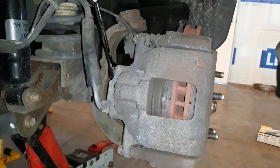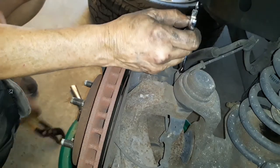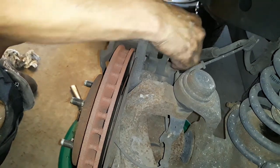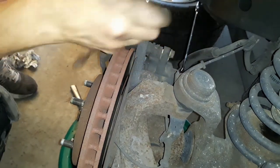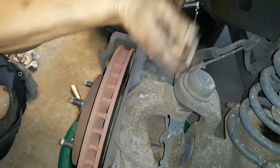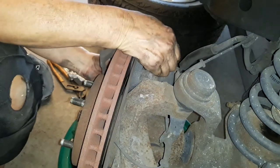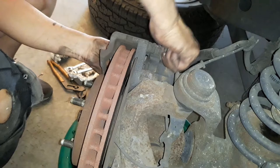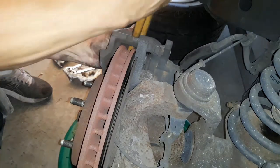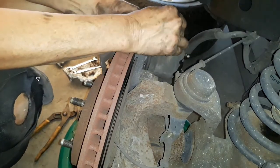These brakes are such a piece of cake to do. My rotors were in great shape so I opted to just do a straight change out of the pads. The pads on the rear were in some pretty pitiful shape — I was lucky to have maybe about an eighth of an inch left. On the front I had quite a bit more pad; I would say they were probably two-thirds used, so I still had a third of a pad left.